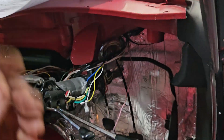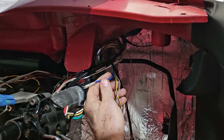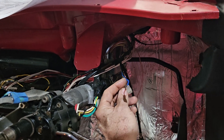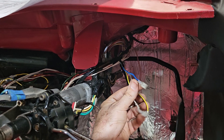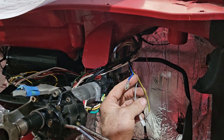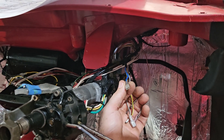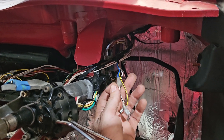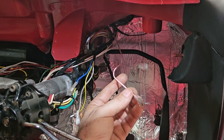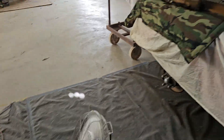Going back to the inputs on the fuse box — the wire that came off your alternator for the signal comes into this blue wire here. These two attach to the bulbs on your dash indicator, and this one comes to the bulb that shows the light come on at ignition and then goes off when you start the car. One pink wire coming in attaches to the dash and powers your instrumentation.